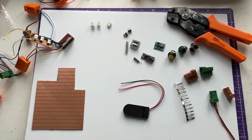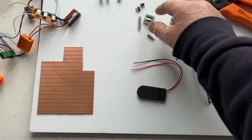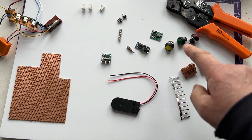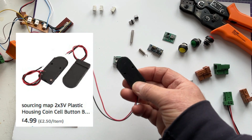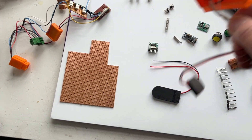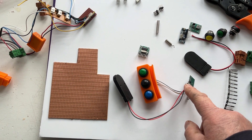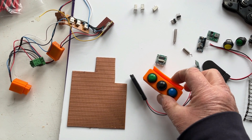These are the components you need to make your remote gear change to fit on the steering wheel. We have this little four-channel transmitter that connects up to three buttons and a little aerial, powered using two lithium coin cells in this little battery holder. You put it in a 3D printed housing - once assembled these just stick inside the steering wheel cover with some double-sided tape, and it slots on the side of the steering wheel.